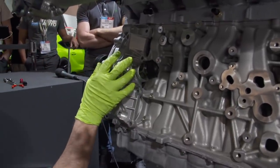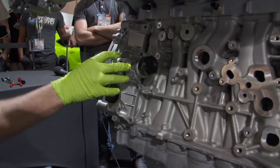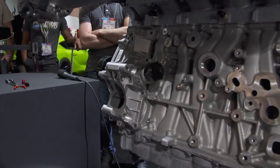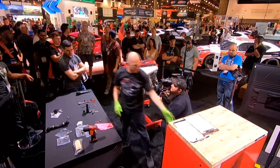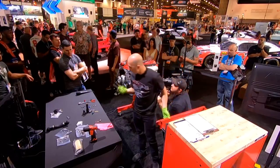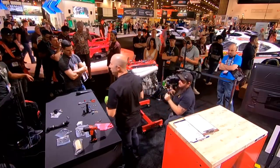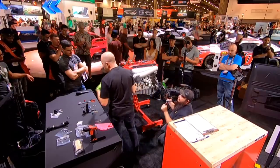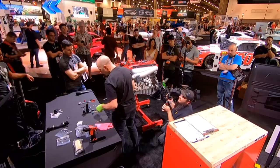And we do still use the mechanical water pump. And in the future, we'll probably continue to use it. We've had great luck with mechanical water pumps versus the electric stuff. But what can happen is, if you're running the engine at a lot higher RPM than it was designed for, sometimes you need to underdrive it a little bit. So what we'll probably do is go to a smaller crank pulley to underdrive everything. Instead of doing individual pulleys, we'll do everything.